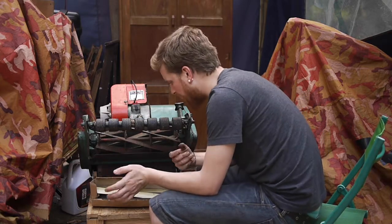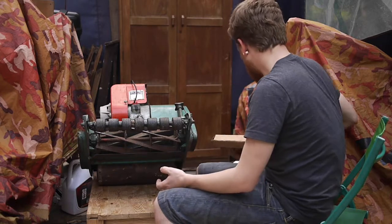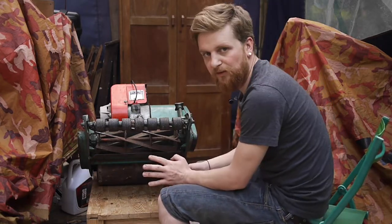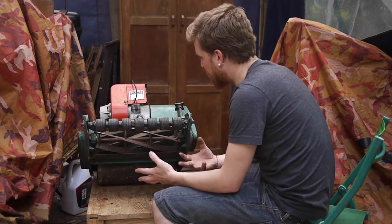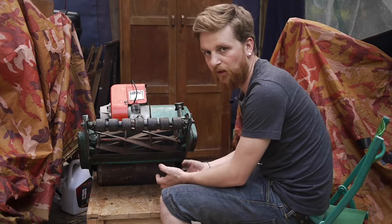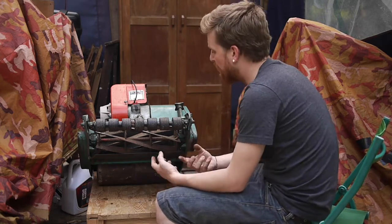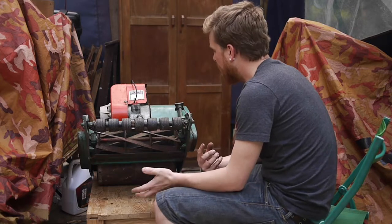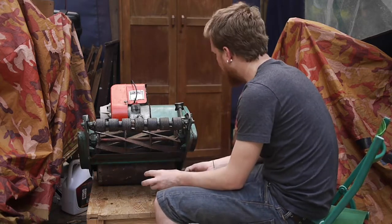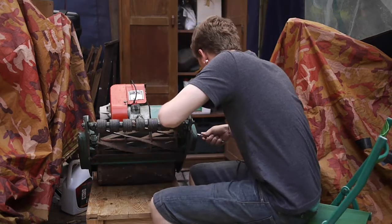The bottom blade is fine, I mean, see, it's fine. So first thing to do is to take off the side panel here to see if we can spin it without starting the engine, because if we start the engine we have to worry about the fact that when it's spinning it's also possibly going forwards. You're supposed to be able to not go forwards whilst you also have the blade spinning, but there are some little clutch adjustments I haven't bothered with and it might just go off into the distance at any moment.